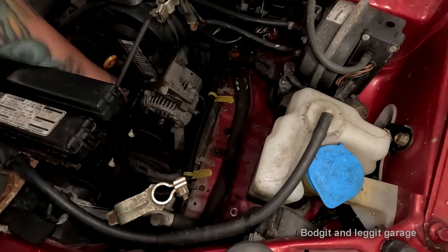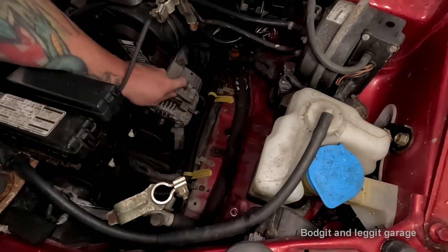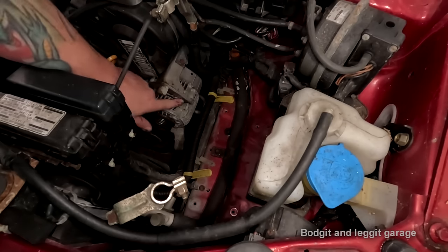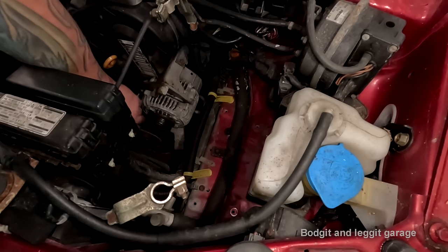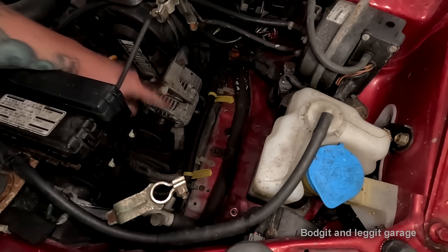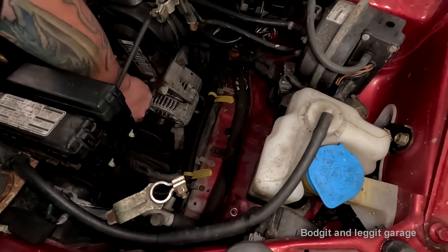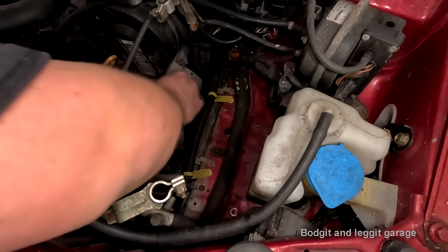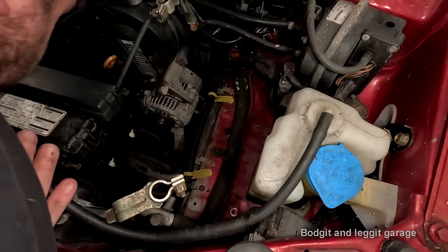And when you tighten the alternator, make sure the bolt I'm taking off now isn't tight, because sometimes this bracket has to move to slide. Now this one is actually slotted at an angle, a semicircle, so maybe this one doesn't need to do it. But some of them of this style, you have to have the bracket loose and the alternator loose, because they both move together to tighten it, if that makes sense. But now that's still solid. And where did the adjusting bracket go?